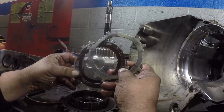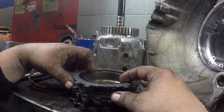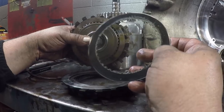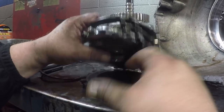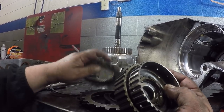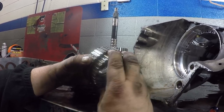Coast clutches — they are damaged. They're kind of flaked off. There are two coast clutches and those are smoldered as well; there's nothing left on those on the side. This is a sprag. It should turn one way but not the other — so it turns that way but it holds that way.